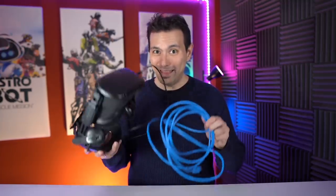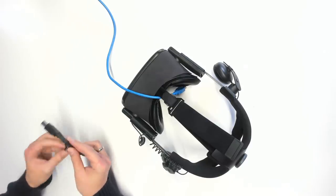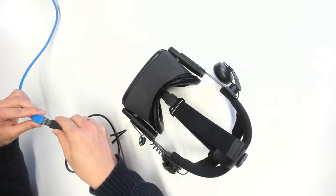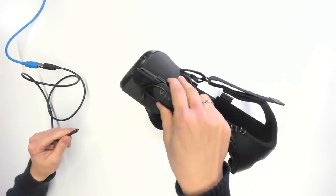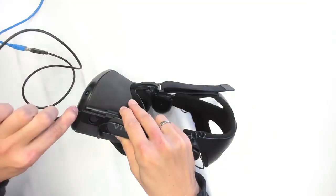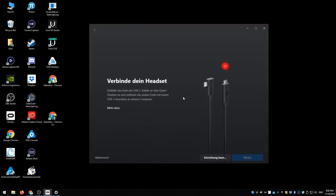Now let's check out if this works. I put the blue extension cord into one of my USB 3 ports on the computer, and this shorter USB 3.1 cable A-to-C I'm plugging in here — the C part goes into the Oculus Quest, which is already turned on. The big moment of truth: plugging it in. On my desktop it says 'Set up Oculus Link' in German, and the red cross on the top right tells me unfortunately my cable or port is not fast enough.